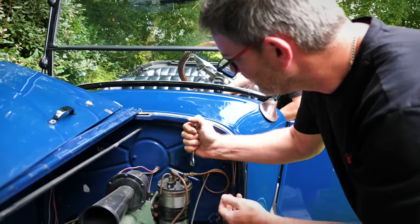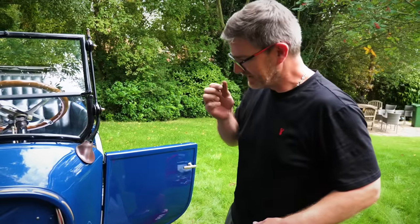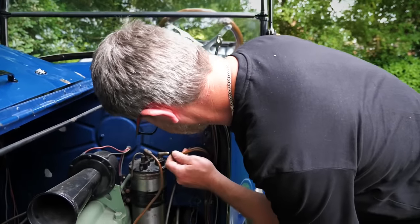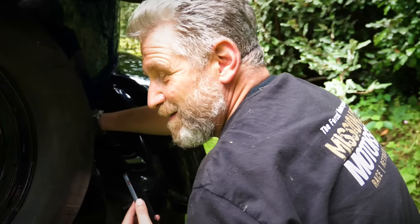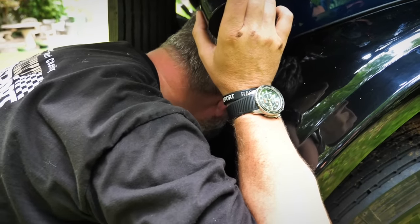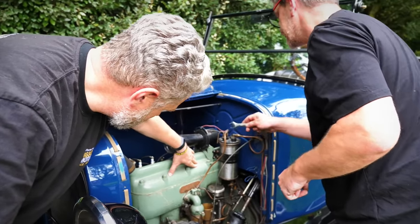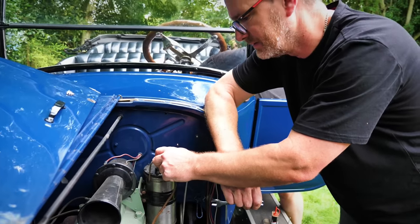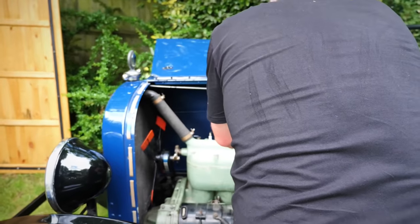I've got to wrap my lips around your pipe. Things you have to do for content, Rich. I've been wanting to do this for ages, Jim. Did you get some bubblage? I saw bubbles as soon as you did that. So this thing here is the vacuum line. If I take this off and hold my finger over it, I should be able to feel some vacuum. Press the button. There is vacuum - it's not brilliant, but there's definitely some vacuum going in.